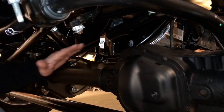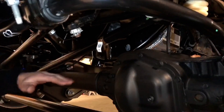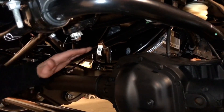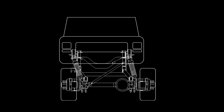This is true for hitting bumps or on any other adjustable suspension system on the market. This arc results in side-to-side motion as the truck goes up and down. The factory does a decent job of minimizing this effect by keeping the bar horizontal or relatively horizontal. However, when you lift a truck, that angle becomes more extreme, which in turn amplifies the amount of side-to-side motion of the body.